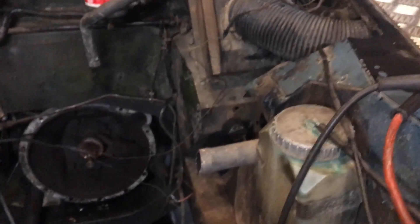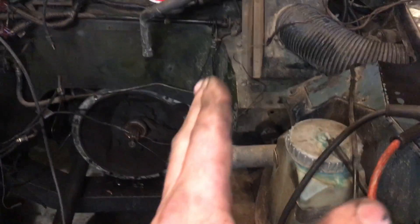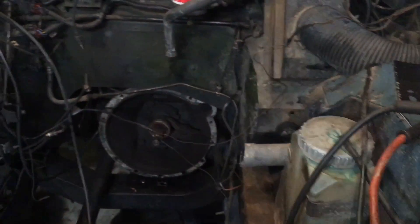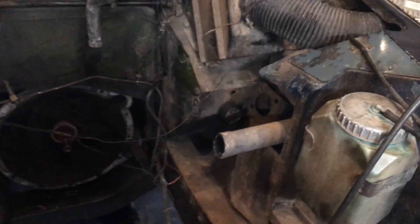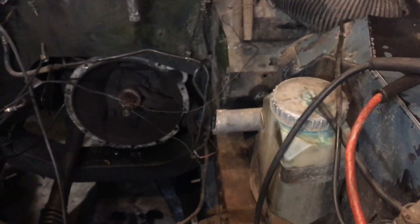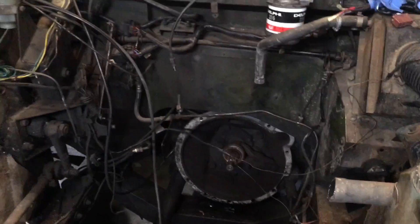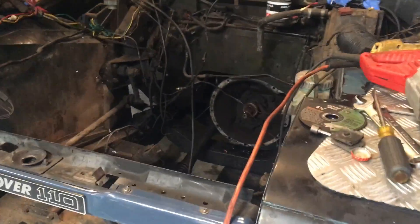You may have better luck than me when it comes to getting your downpipe off your exhaust. Mine had four bolts frozen on so badly that I just went ahead and made as clean a cut as I could. I know it's at a slight angle, but if I need to I can weld that back on if I want to save this exhaust system. I'll take more time to do the rest a little more carefully. We're going to tidy things up, get it nice and clean, and move that motor mount out of the way before we push this back in to clean and make our actual plan.